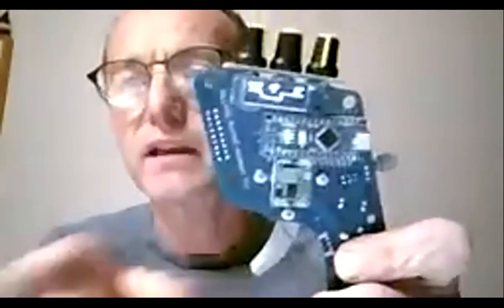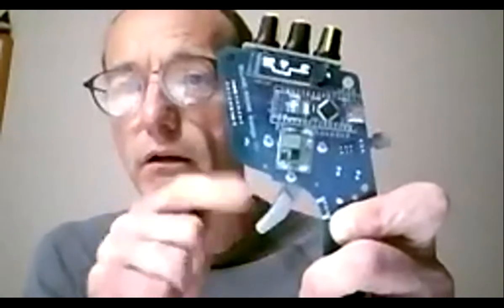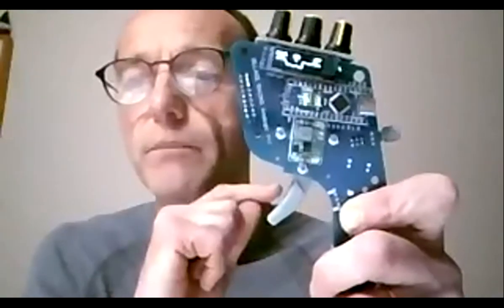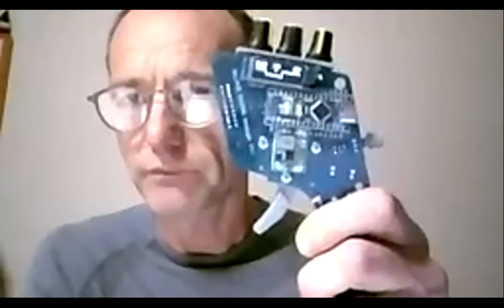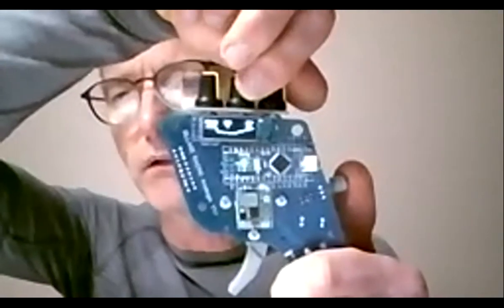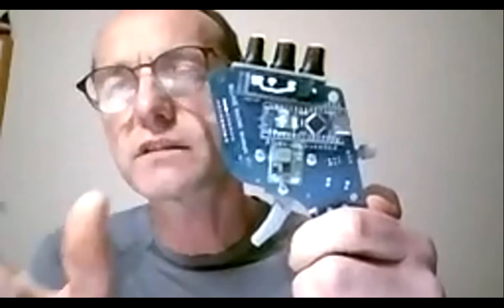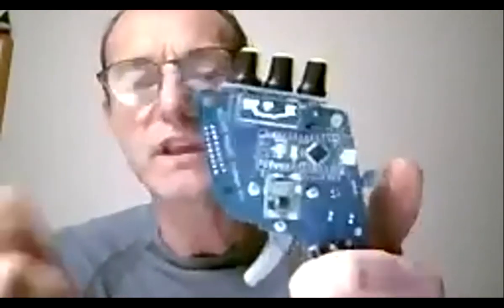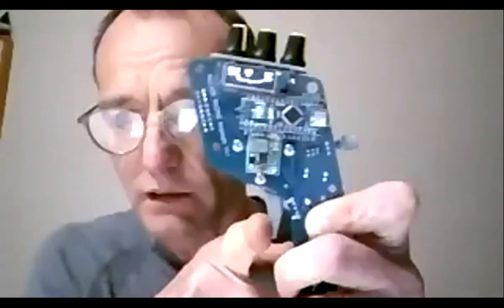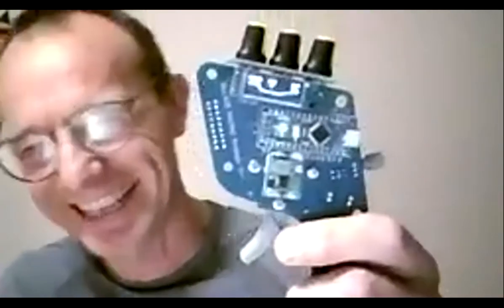It's only a delay. And if you have zero like this, when you throttle very quickly, the power will go to the car very quickly. But if you do like this, for example, the maximum is 10, just less than 1 second. When you do like this, the power will go to the engine. Yeah, it's working as a throttle damper.